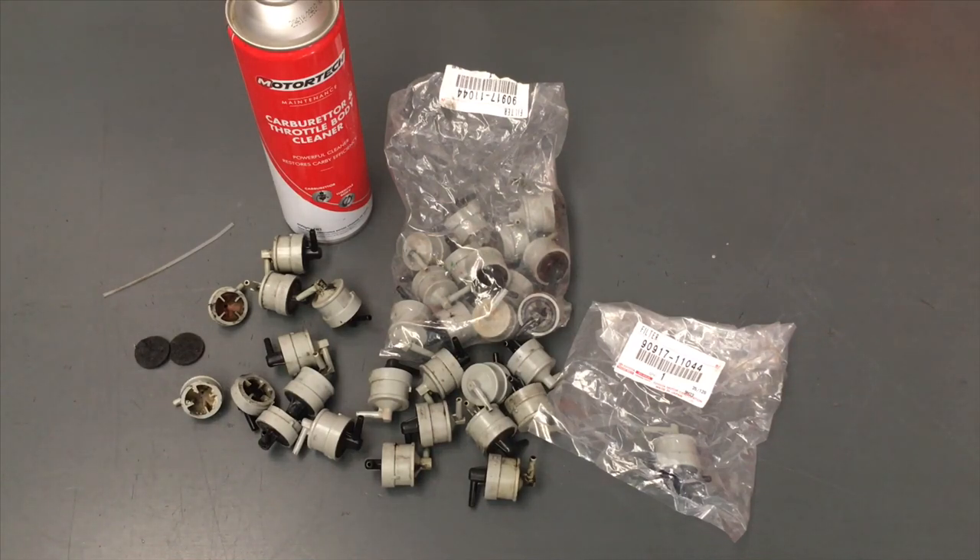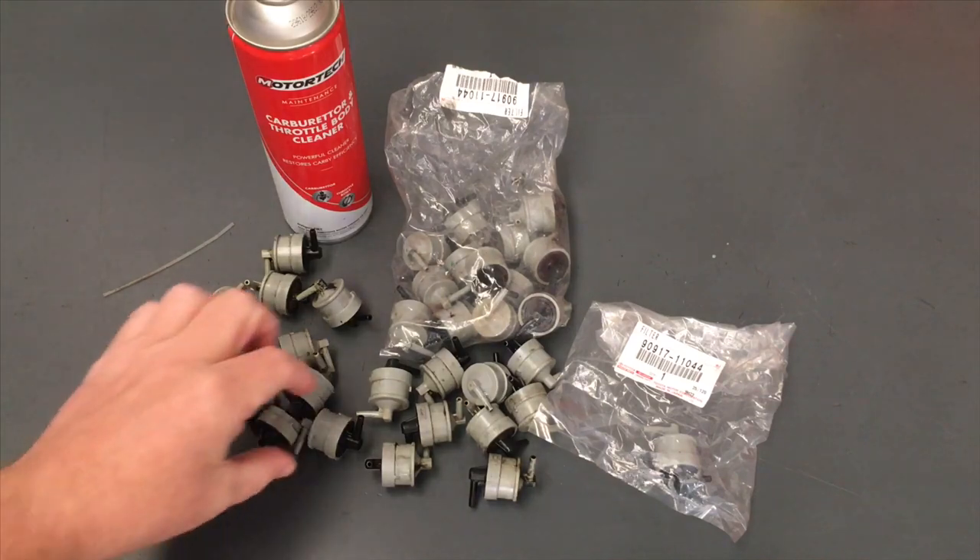Now, what happens with the filters? They're on the intake. What's in the intake? You've got a small amount of oil and you've also got soot from exhaust gas circulation. This EGR causes a number of problems with the vehicle — it's not just caking up your intake, it affects different sensors and systems in different ways. There's a whole lot of downsides to EGR, and one of the things is this filter blocks up.